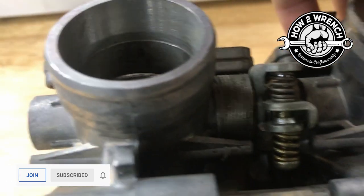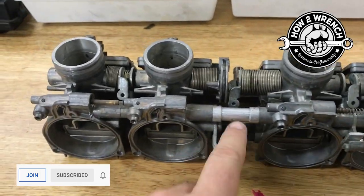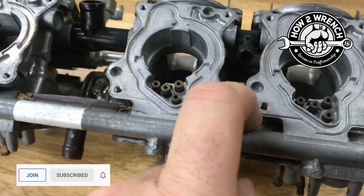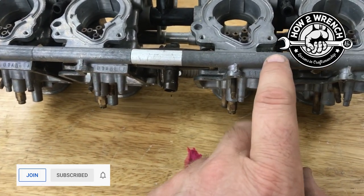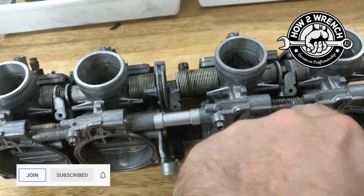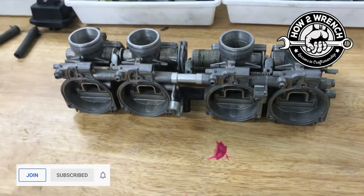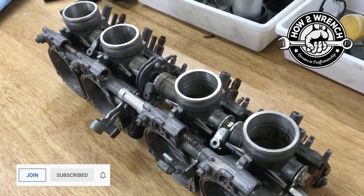That little top spring right there will come loose — there should be another one there, there is, and there is. So all three of those are there. Also be mindful when splitting: this little spacer right here is going to come loose. Then you have the vent tube for the CV side, a fuel inlet — a singular one — two crossover pipes, and another piece that separates off. There's more than likely dowel pins here and here.